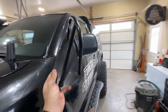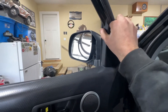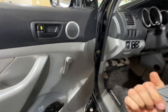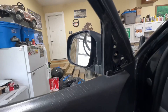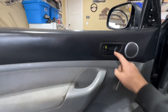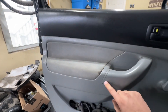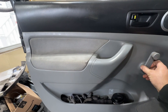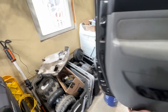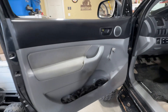On the second gen Tacoma, that piece of trim is about ready to fall off. It pulls out, and it looks like to get to the bottom hardware we're going to have to pull the door panel, which isn't too big a deal. There's a fastener here, and under the handle there are a couple more. Then you pull the window switch, which has a clip — you push the clip off, pull that, and I think the rest is just getting in behind it and releasing it.